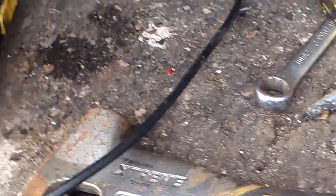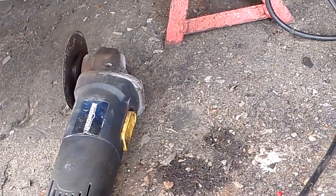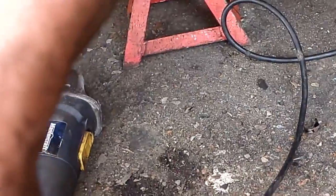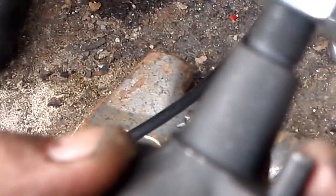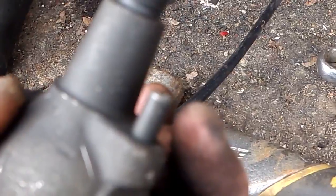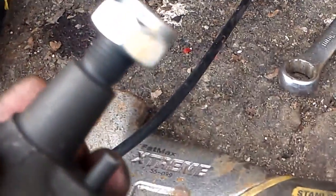And then we'll, oh, I'm running out of camera battery. Then we'll pop the back one in, and I'll come back, and the bottom one goes in afterwards. It's just a little tricky to align the little locator pin hole with the arm. There's a little hole in the bottom of the arm that it goes into. If you find it hard to locate, just take a file and file this into a point at the end, so it will help guide it into the hole a little easier. Won't hurt anything. This is just a locator pin. Once the end goes in, it'll pull the rest in. So if you file this a little bit rounded on the end, it'll be easier to pull it in.